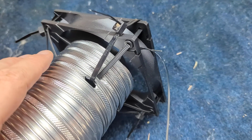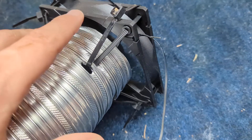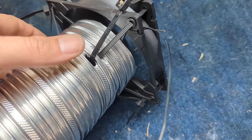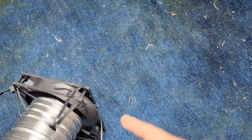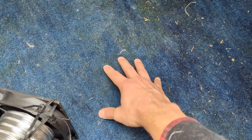I had bought a smaller fan when we went to do this but it actually fell in the water, so we used this one as the spare. It's working fine — obviously the size difference is a little off as you can see, but it still works. We've just zip-tied this onto the tubing and it's held in place pretty strong. I let it sit near the ground where the moisture is really building up, so it pulls air through the tubing and forces air through this area to dry it out. For the first time this season it's bone dry in here.